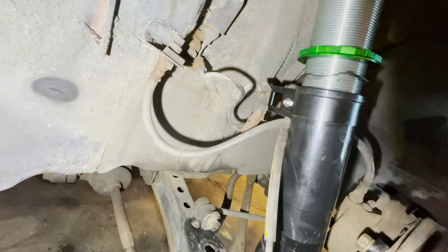I also did not route my brake cable through that square holder at the moment. When I do my hydro brake I'm going to take the whole system apart, but I really don't want to bleed the system right now. For my stock shock height I'm going to start at 3.5 inches and see what happens — the back is at 3.5, so I'll start the front at 3.5 as well. I also noticed that the front sway bar doesn't seem to have a spot to reattach to. If I can't take it all the way out — it almost looks like it goes to the front subframe — I'm going to take off just these little arms and leave the front sway bar in for now.